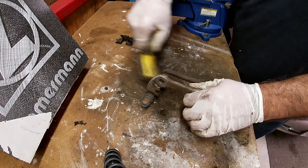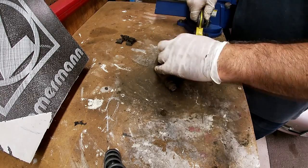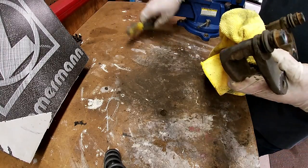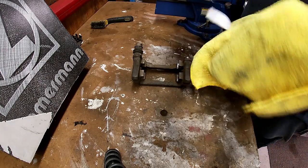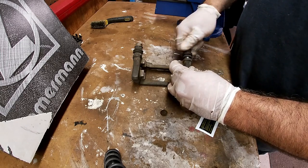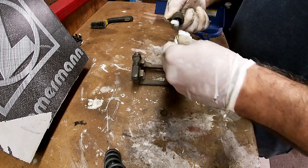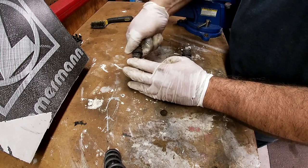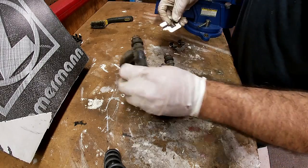It's pretty clean — anything that could get in the way is gone. Quick wipe, throw the old shims out. Now let's put the slides back. Just going to clean that off and put some new Techstar lube on there. The caliper hanger is redone.